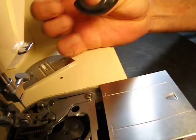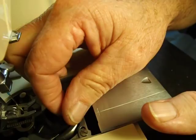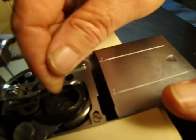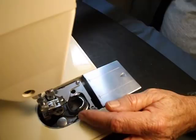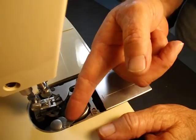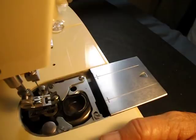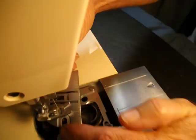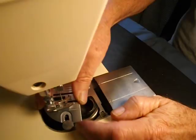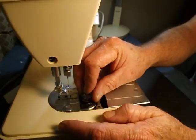To put it back in, you have to get it down in there and adjust it so that this little fork gets locked in at the top. Put the back side in and wiggle it down. It locks in that fork and goes over a post. Then move this steel lever back so it's held in place. Then to put the needle plate back on, slide it over at an angle, get it under that lever, hold it level, slide it over and drop it down. Pretty easy, especially after you do it a couple of times.